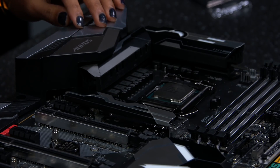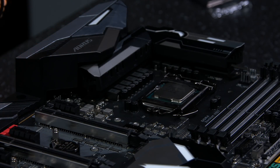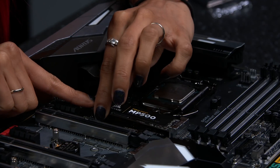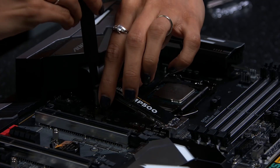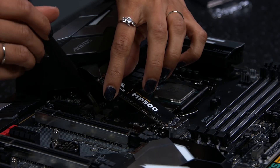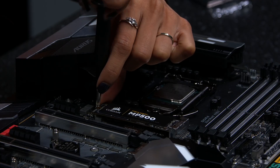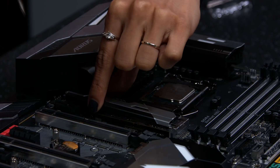To fit the M.2 drive, unscrew and remove the heat shield from the motherboard. Test place the M.2 by sliding the drive into the slot just beneath the one the heat shield used. If the screws line up well, make note of where the securing screw was before removing it. After removed, hold the screw base firmly while unscrewing the small attached screw. Attach this base back to the motherboard where you noted before, then press the M.2 against the base, screw it down, slot the heat shield back in, and screw into place.